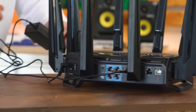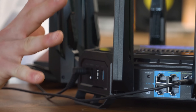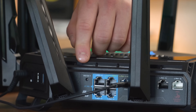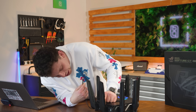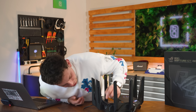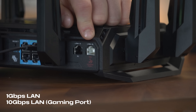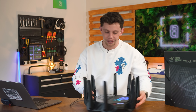Now the juiciest stuff around the back. I've got the power brick plugged in here. We've got a USB 2 and 3 port for external storage and connecting USB devices. And then here, this is where it gets really interesting. We've got a quad LAN setup, but there is actually a 10G Ethernet port — 10 gigabits per second — and it can be used as WAN or LAN. On this side we've got two more LAN ports: one standard one gig port, and then the gaming port at 10G. As far as future-proofing is concerned with 10G coming into people's homes, this should have you covered.